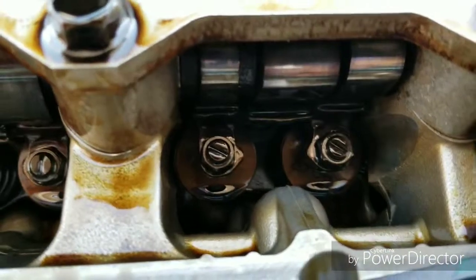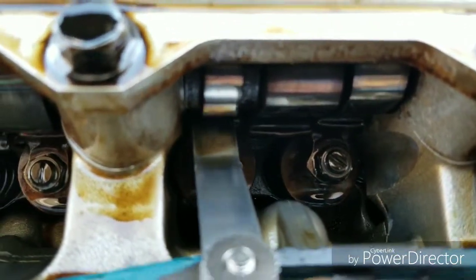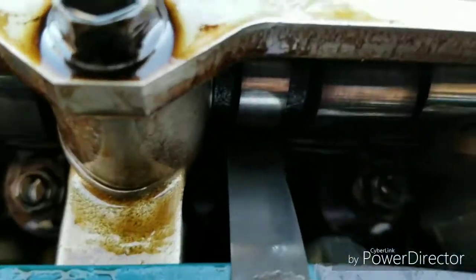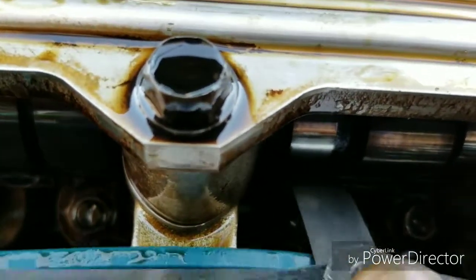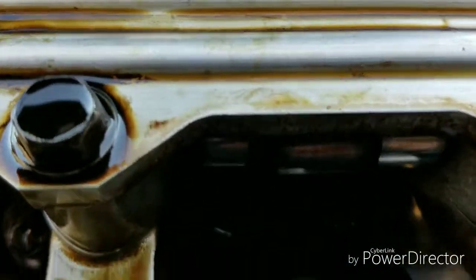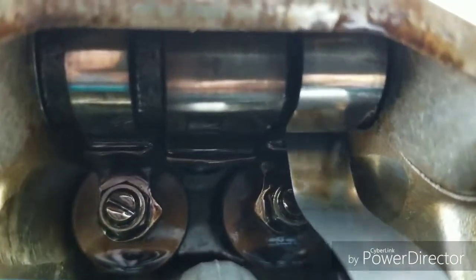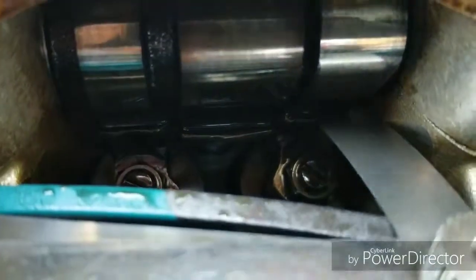And the way I adjust it, I'll go right in between the cam and that flat part. And as you can see, it can go in with the 8. It slides in. It has minimum resistance for that one. Don't worry about the center. That's the VTEC lobe. You don't need to adjust that. So once again, I go right in between the cam and this flat ledge right there.